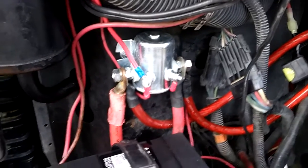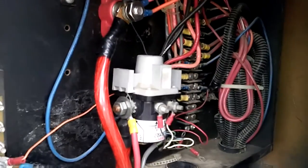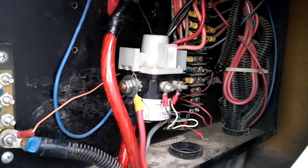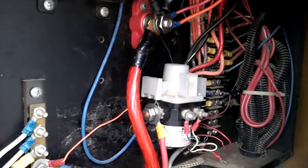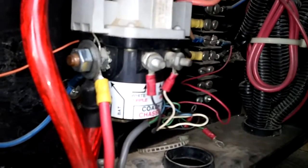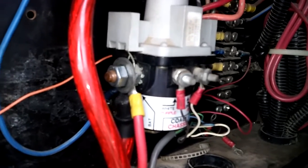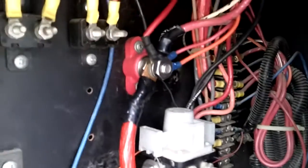The reason I got it is because in this giant junction box, they have two solenoids that are actually just battery cutoff switches. When one of them went out, I used a small wire to connect up both sides of the solenoid. But I realized that if that happened with the starter one, I'd have to use big wire. So I just eliminated it and put in that stud, which cost about seven bucks.